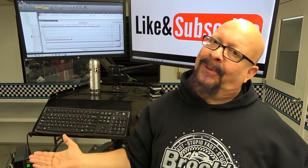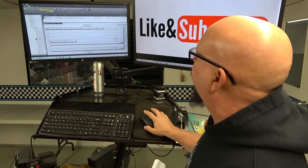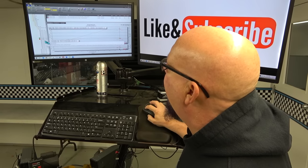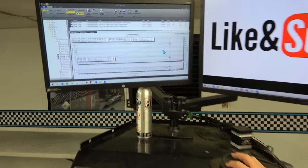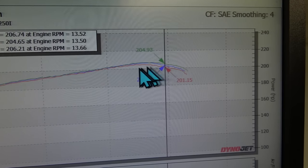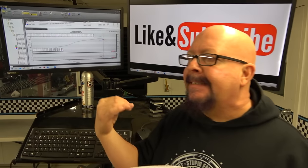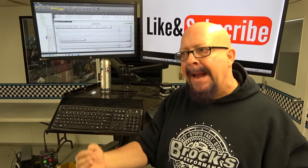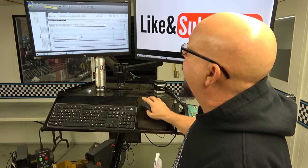Now, let's go apples to apples though. I hadn't optimized the fueling yet for the Gen 5 stacks, so we're going to go ahead and throw that in. Now, come on back here, and you can see, all right, so that's the blue line. I split the difference between the red and the green, but the Gen 5 stacks just couldn't make as much horsepower optimized as the printed.